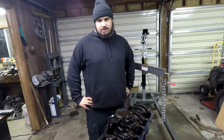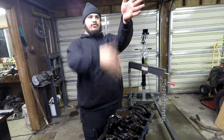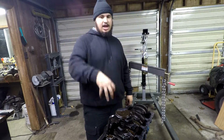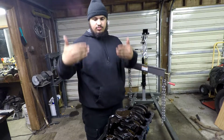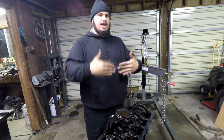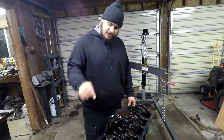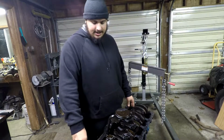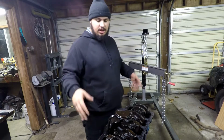It was a 3406B Caterpillar, and what we did was we took the block and we set it up vertically so that we could take the cam and just pull it straight up and out. We didn't have gravity, you know, when we got the cam out of its journal, pulling the cam down so that we got hung up on stuff. So this is going to be a little bit different. Because it's horizontal, I'm going to have gravity kind of working against me while I do this.